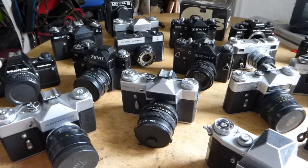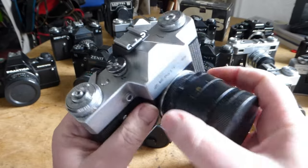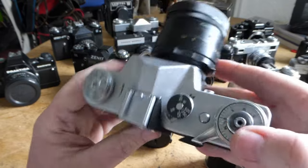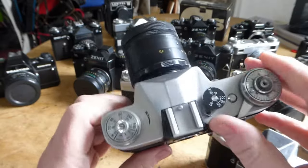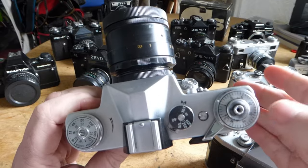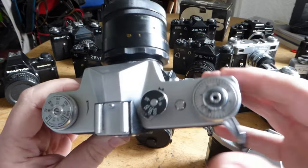When I say the simplest camera, I mean the simplest single lens reflex camera. This one dates from 1969 and it's got a screw mount lens. It's got a shutter speed selector that allows you to go from a 30th of a second to 500th of a second. There's the rewind knob, film advance which winds the film on and also cocks the shutter, and then you press this button here to fire the shutter.